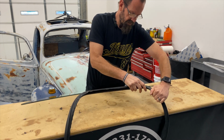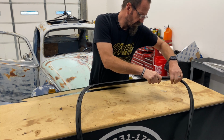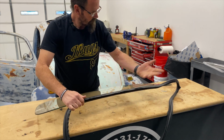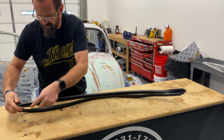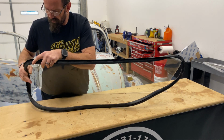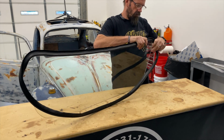We have these made specifically for us, to our specifications. We made them a little bit longer than some of the other seals out there so that they're less prone to curling in the corners. Note that I put the seam at the bottom center. Another thing that causes window seals to curl in the corners especially is if they're stretched super tight. So whenever possible, try to keep your seals loose at these corners to alleviate some of the tension, and that will help them not curl.